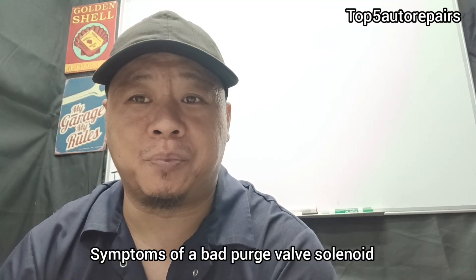What are some of the symptoms of a bad purge valve solenoid? Well, you're going to get P0442 to P0445. Also, when you go to the gas station, pump gas, and fill up your tank, after you start up your vehicle the engine starts to run funny. That's because the purge valve solenoid is stuck open and is allowing a lot of fuel vapor to go inside the combustion chamber. So remember, at startup the purge valve solenoid should be closed, and the computer should command it to open when the engine is warmed up. When it's stuck open at startup, it allows fuel vapor to enter the combustion chamber, upsetting the air and fuel ratio, causing rough idle.